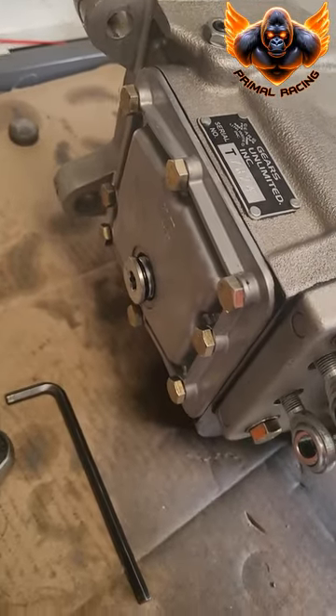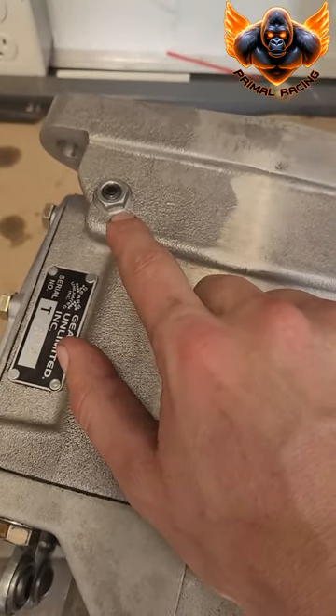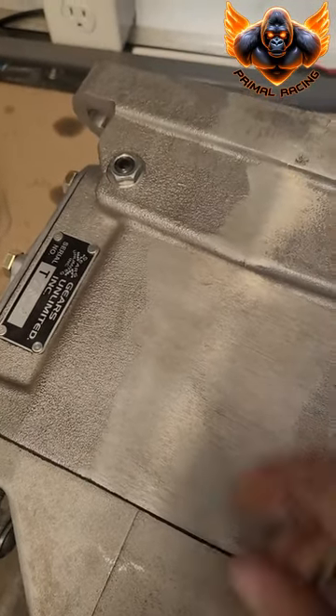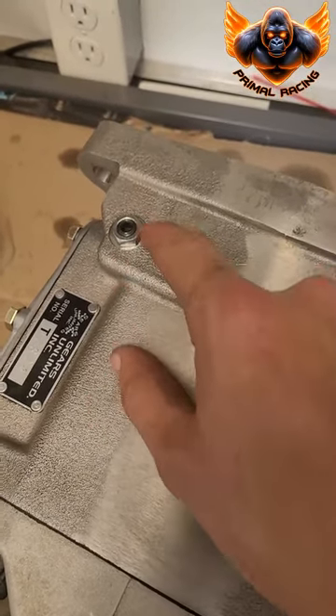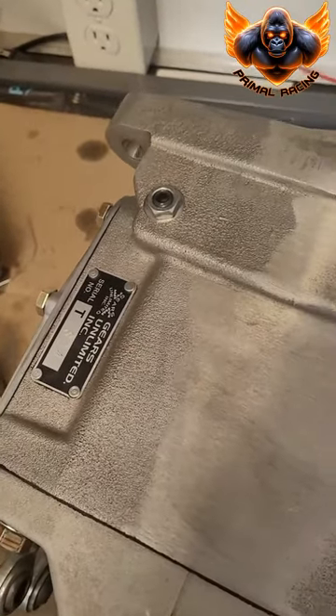The last step after the side plate and plug is to put in the last detent ball, detent spring, and the adjuster. Factory setting is half a turn off the bottom, so I just ran it down and adjusted it half a turn off the bottom — I'll fine tune it at the shop later. That's it — Falcon transmission rebuild! Hope that helps. The guide is pretty useful but sometimes it's really good to see a video. Thanks for watching — if you learned something, please like and subscribe and we'll see you at the track soon.